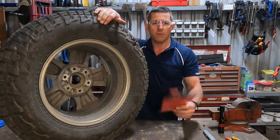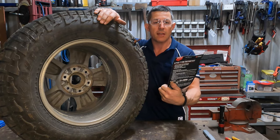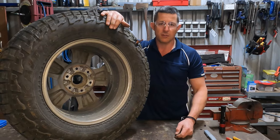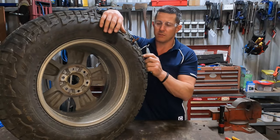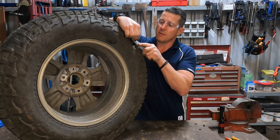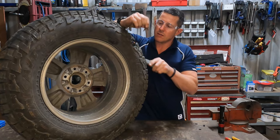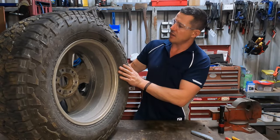So there you have it — there's our repair. Not a zip of air coming out of that. That was the review of the use of the eight-piece SCA tyre repair kit, which we picked up from Super Cheap Auto. I think it was 20 bucks or something. That's got us out of trouble and it will last. They recommend nipping the plug tails off with side cutters, or if you're in the field, a Stanley knife — just cutting these off a little bit. Go away from the tyre of course. Cut that one off. It doesn't have to be flush — if it's on the tread part it just wears off. That's a good repair.